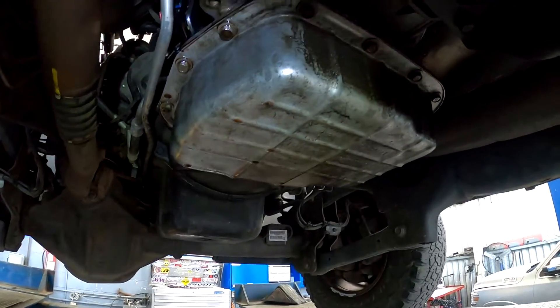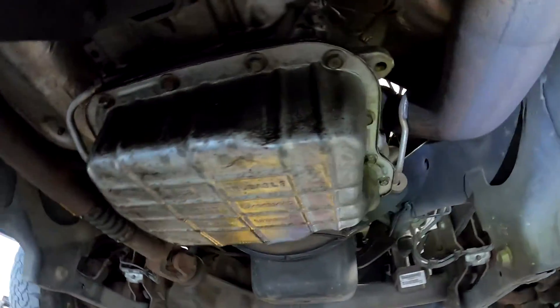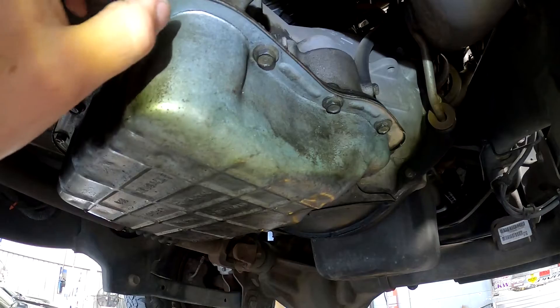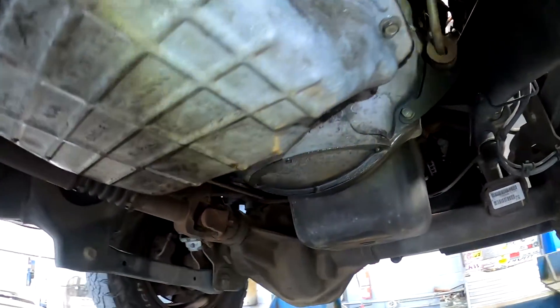Looking at this leak, it's leaking quite a bit. Just sitting for a little bit, it's kind of puked a bit of fluid out. You can see that initially this would probably be diagnosed as a transmission pan. On this side of the pan it is pretty sweated — sweating indicating that a little bit of fluid is getting around the plastic gasket right there, but it's not that wet.